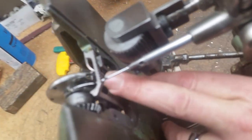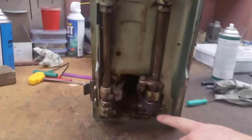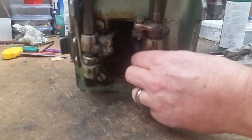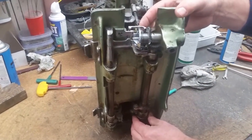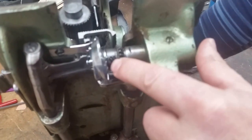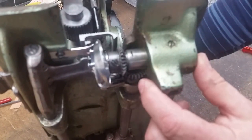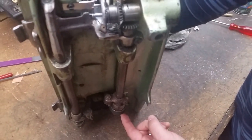If you put your finger right there and move it up, you'll see the point of the hook is now right behind where the needle is. If you have a short point on your hook, you might have to adjust it closer. But for needle height, timing, and where you adjust your timing — if that is too far away when you bring it up to that point, there are two screws on the back of your machine where the belt connects. Loosen these two screws, turn this by hand — that disengages the top half of the machine from the bottom — and that will allow you to turn it so the point of the hook is behind the needle, then tighten them back up. A lot of people make the mistake of trying to time their machine using the screws by the rotary hook. There is a flat spot on this screw that has to be engaged with that screw. If you get off that flat spot, it will jump time very easily. First, make sure that screw is on the flat spot, then do your timing with the two screws on the back side of the machine.